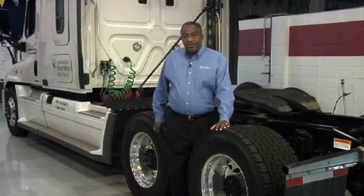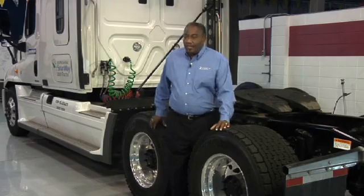By properly inspecting the tires and wheel-ends during every pre-trip inspection, drivers can comply with federal regulations and make the highways safer for themselves and other motorists. A wheel-off or wheel-end fire can occur when any component on a wheel-end is poorly maintained. Wheel bearings, lug fasteners, studs, and brake components must be regularly inspected and included in the preventive maintenance program. When properly maintained, wheel-ends can last for the life of the vehicle, but when neglected, wheel-end failure is unpredictable with catastrophic results.